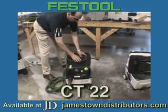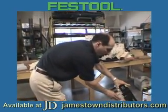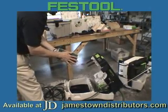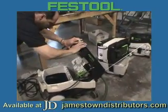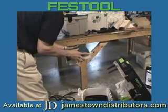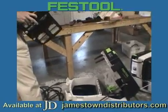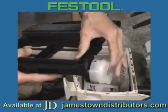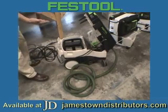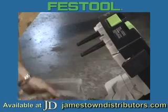The Midi is also a wet/dry vac. If you want to do wet/dry with this one, the two HEPAs come out and the sponges go in. The bucket goes in like that, and then this goes into this hole here so everything flows. When the water level reaches these two contacts, it shuts down the vac. Take the bucket out and go dump it.